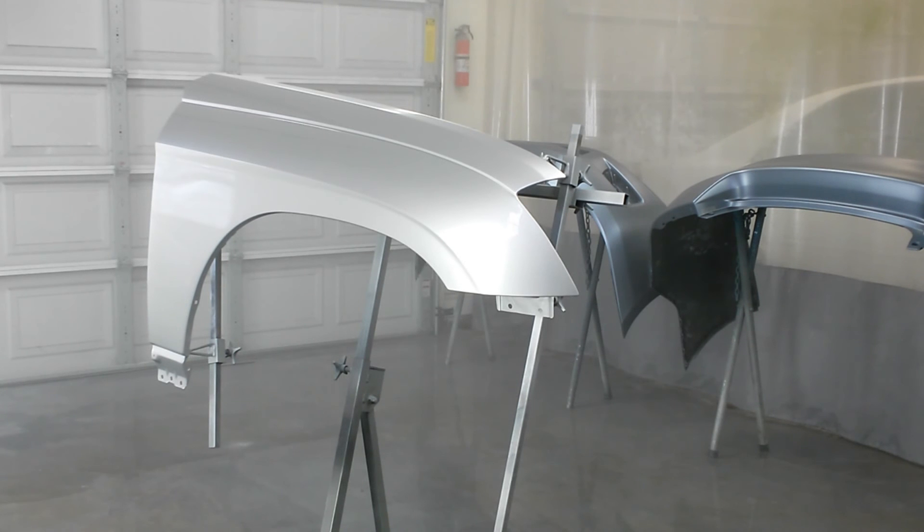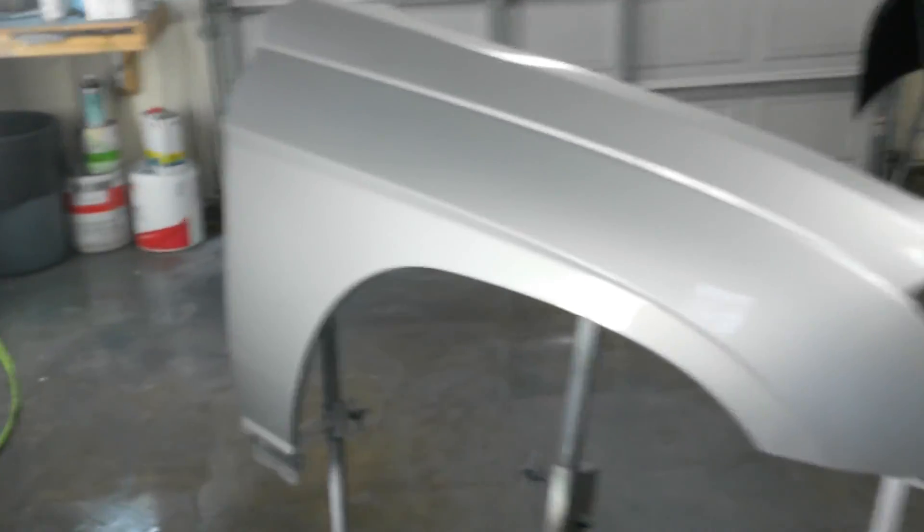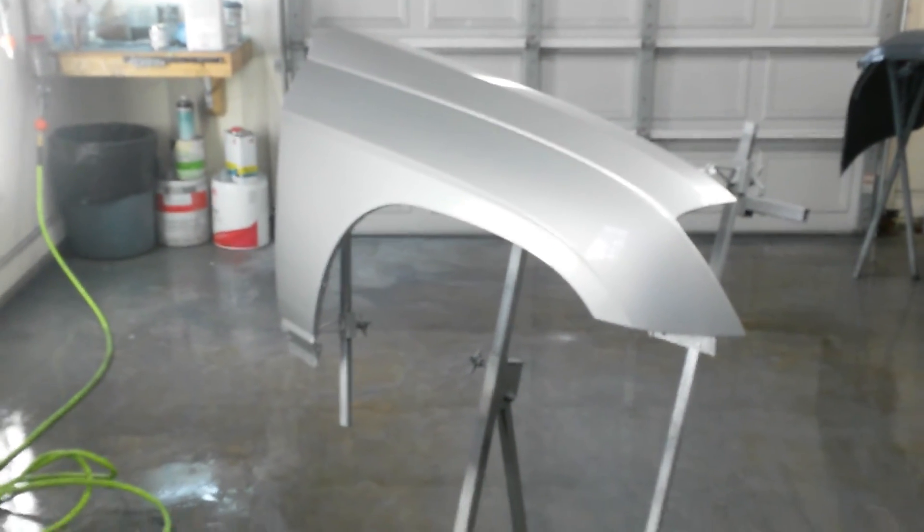That'll get about a three-minute flash and I'll finish it off. I'll actually start on the edges and overlap that with the outside second coat. That's after the second coat right there — turned out really slick. I won't need any buffing at all, maybe a nib here or there, but that's about it. That's going to be it for this video. I've got to take it back to them like it is. See you later.